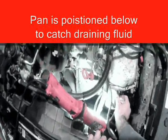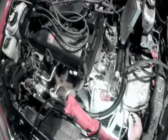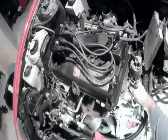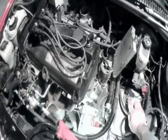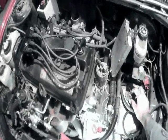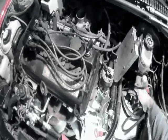And then you've got your transaxle temperature sensor right here. Just squeeze on these 2 sides of the connector and it will pop right off, and then another connector down here. Remove that. And let's see, you've got your engine coolant temperature sensor right here. You can pop that off. You've got your computer control to your valve body right here. It's a 7mm. Loosen that bolt up, and then this whole connector will pop off.